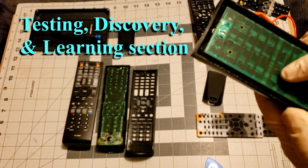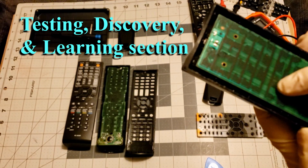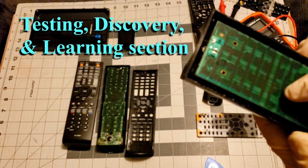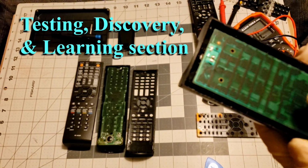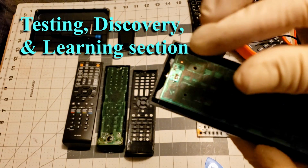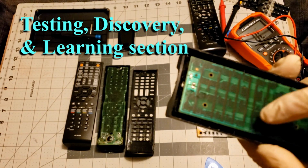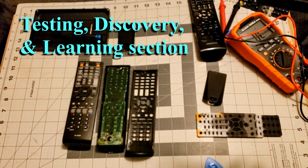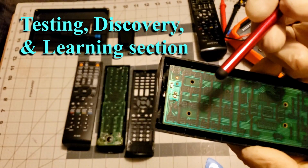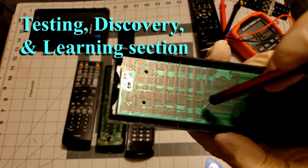Perhaps, this is my thinking now, that there is a small amount of gap between the traces, and so when that button's pressed inside the circuit board, there's a small amount of gap that when the button comes down and presses, it creates the contact. So if that theory is right, I should be able to press on a button area. This is just a stylus pin, and create a contact. And I'm making sure it's pressing fully.